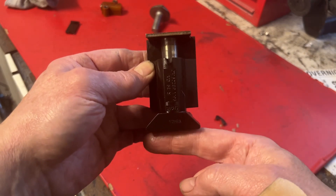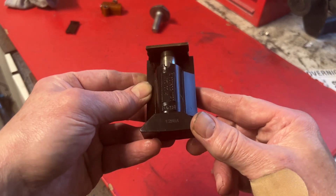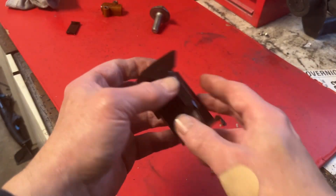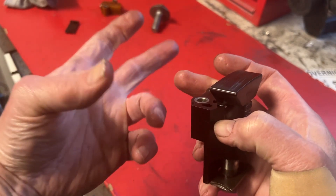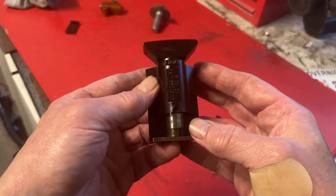There might be slack on the bottom here, and if that's the case you probably have to re-tension the chain on that side. Interestingly, when I looked at your photographs, the flats on the two cams — the locking flats — didn't look to be at the same position, which might be an indication that the timing is slightly out.